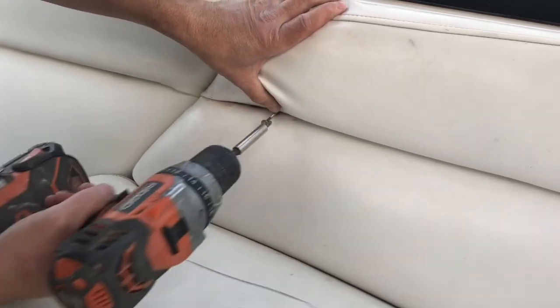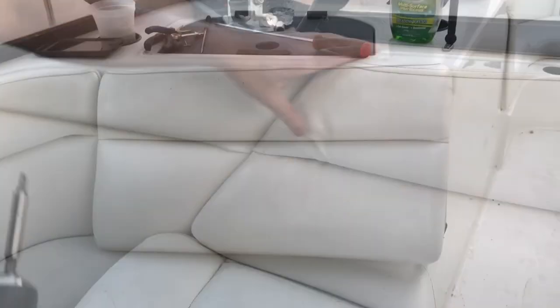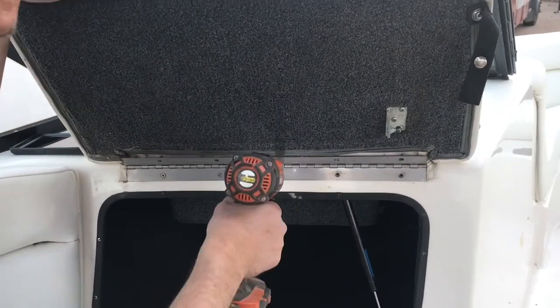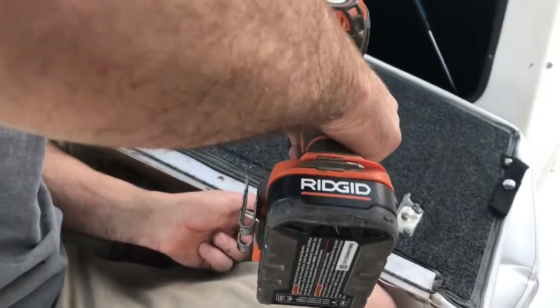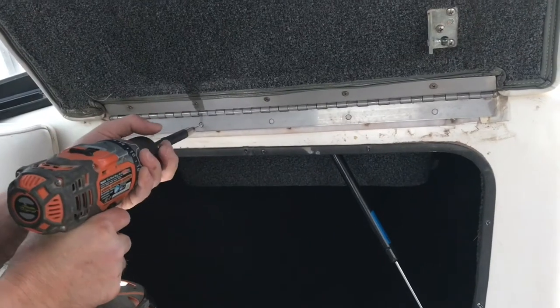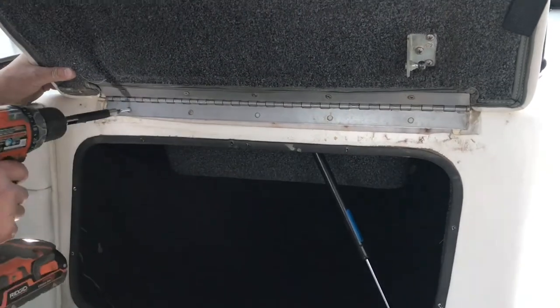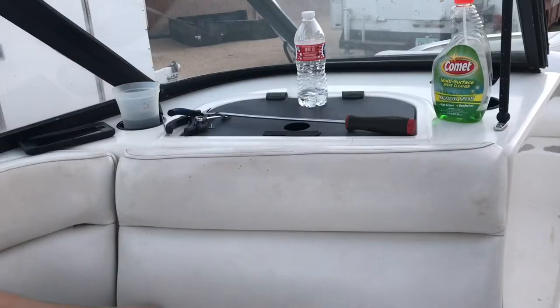There were a couple sections of upholstery still in good enough shape where I didn't want to spend the money to fix them, but I added a couple extra screws because they were coming out of place. One of those cushions was a pain to get into place, so I took the shock off — use a small flathead screwdriver to pry off the plastic or metal tab and it pops off with ease. I also took all the screws off on both sides of the hinge, flipped the hinge around to get fresh material for the screw holes, repositioned it to the right height, and then popped the nitrogen shock back on.